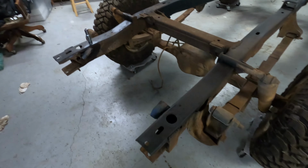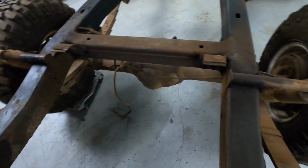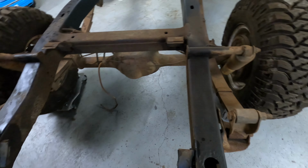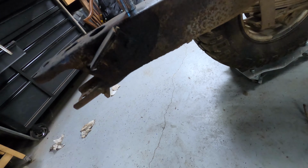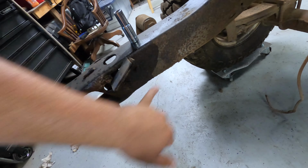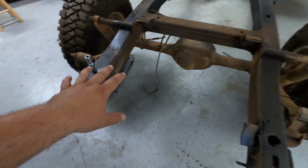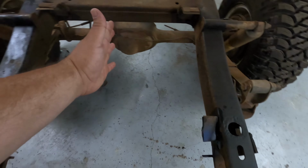But tonight, I'm going to focus on this area back here. Going to take these off. Gas tank holder inners, I don't know what they're called. Don't have hope for that one. I think that one's going to be pretty bad. I see a lot of heavy pitting around here too, so that's got me a little concerned. But we're going to break these loose, sand in here and in here and on top of here, and get all that painted today, hopefully.